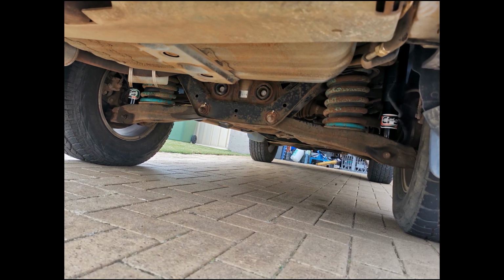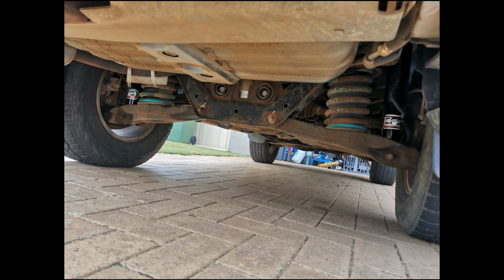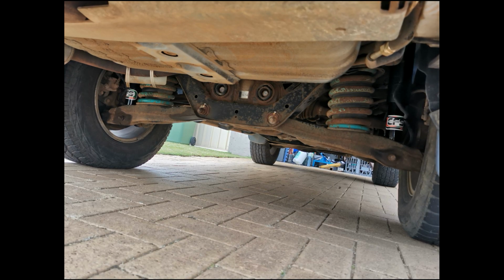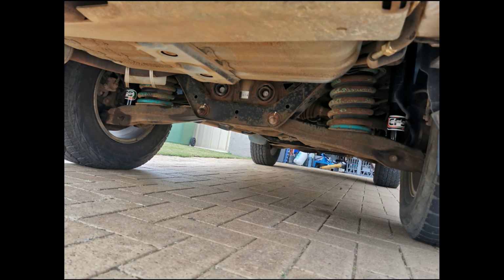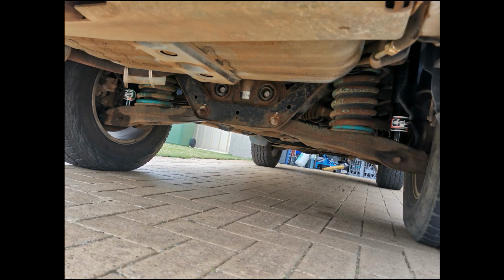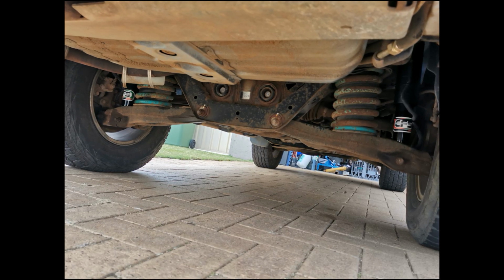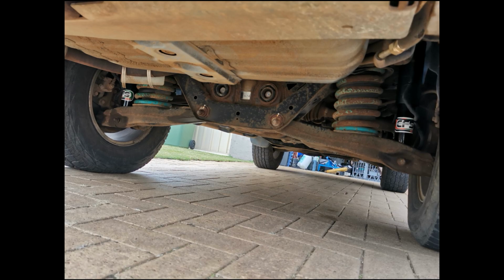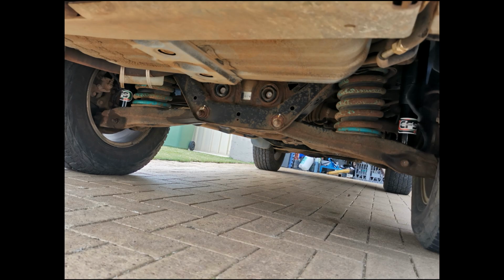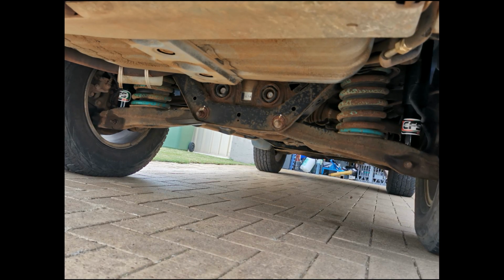The other side of the car is exactly the same. There's no difference between the left and right side. And also, I should have mentioned, with the shock absorbers, you order them as a pair. There's no difference between left and right either. They're the same part number. Doesn't matter which way around. Yeah, you just want to go for a drive, do 15-20 Ks, hopefully somewhere where the shocks get a little bit of a workout, and then come back and retorque the top of the shock and the bolt nut going through the bottom of the shock, and that's about it.